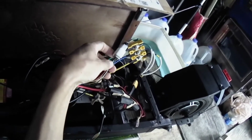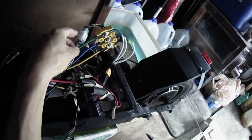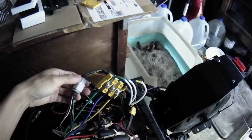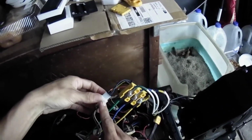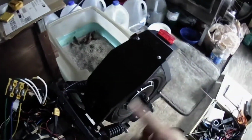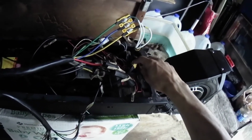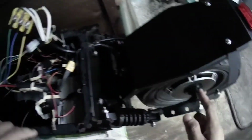These are Hall sensor wires. It's like computer wires. It monitors, it measures data, what's happening in the motor, things like your speed, odometer, calibrations, settings, things like that. More commonly, this is required to be connected. There are some motors out there with the controller where it does not require Hall sensor wires to be connected, but most of them do. So these are the ones you need in order for the motor to turn, for each motor. The front motor has the same thing, 3 phase wires, connectors, and Hall sensor wires, and the battery wires. You need the battery wires connected to the battery from your motor.